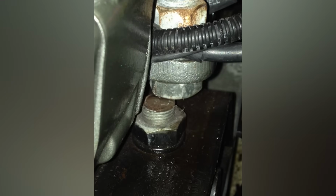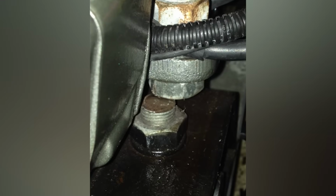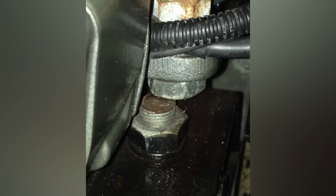Excess vibration through the transmission, the prop shaft, and the prop tunnel can cause structural damage, including possible water infiltration. Also, if a mount were to actually break, all of the above plus engine damage can be the result of badly worn engine mounts. With the engine mount so worn out, in addition to its close proximity to the transmission and prop shaft link, it causes excess vibration while under load, both in forward and reverse. Plus, it means the starboard rear mount has been compensating by taking on the extra stress, therefore was also getting more wear and tear than it should.